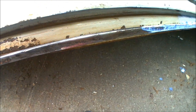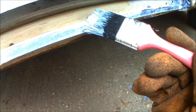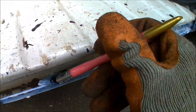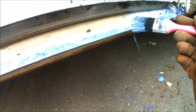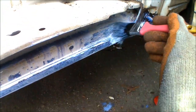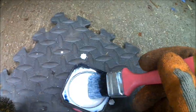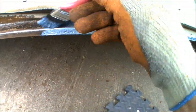When you are applying the Krust to any affected metalwork, you should actually start to see it react quite quickly — you should start to see it turning a purpley-blue haze. If it doesn't start to turn that colour you might need to reapply it, as it says in the instructions. I've literally just applied that there and you can already see it's starting to turn a blue colour. You want to give it a good smothering with the Krust and make sure you're getting into every nook and cranny. You don't want to be putting a brush back into the actual tub, so always try and use a little separate tub — you don't want to contaminate the Krust with any flaky metalwork that might be on the brush.